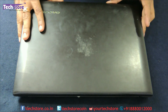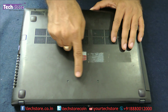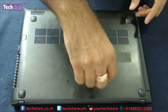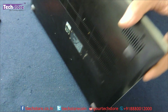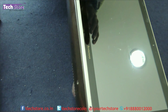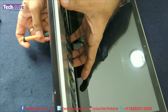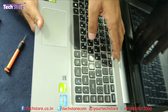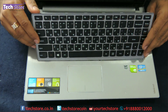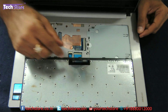Flip the laptop and the first thing we are going to do is replace the keyboard. For replacing the keyboard there are two screws that you have to remove. Then take the laptop and start protruding from the keyboard wherever you removed the screws, and you will see the keyboard coming out. Very gently start removing the keyboard, and you will see this connector over here which is holding onto the keyboard — remove it so that the connector strip is out.